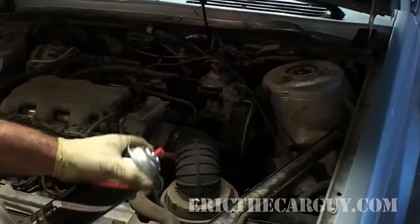Also, if you do this with the engine cold, you're much better off. A vacuum leak creates a lean condition, and many times what the car will do to compensate is it will richen up the mixture. Now, some vacuum leaks you can hear — I've got a pretty good ear for vacuum leaks, not for beeps of keys, but a pretty good ear for vacuum leaks. So when I hear that high-pitched hissing noise, the first thing I look for is a vacuum leak, particularly if there's a performance problem. Or if you get into more advanced diagnostics, like looking at short and long-term fuel trim on a scanner, you'll notice that it goes rich. So if you see something that trends rich, it may not be the O2 sensor — it may very well be a vacuum leak. In fact, that's the first thing I would look for.